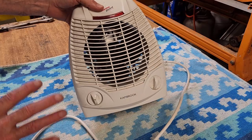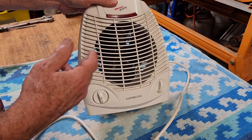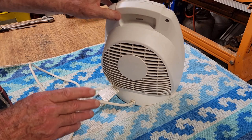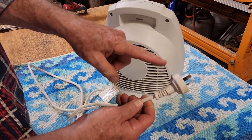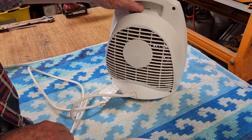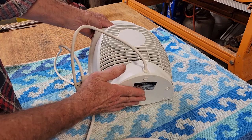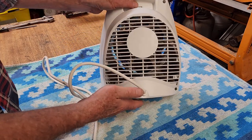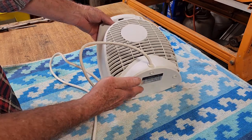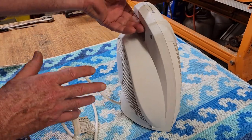Let's start with some basics. If you've found this video because you've got an electric fan heater like this and it's not working, just run through some really quick, simple steps to work out why — you may be able to solve your problem easier than you think. Firstly, make sure your power point has power by plugging something else in. They often have a switch on the base — that's a protection switch in case the thing falls over. Check that that operates. Those are two of the main reasons why it won't run at all.